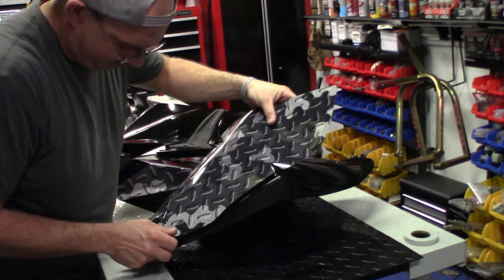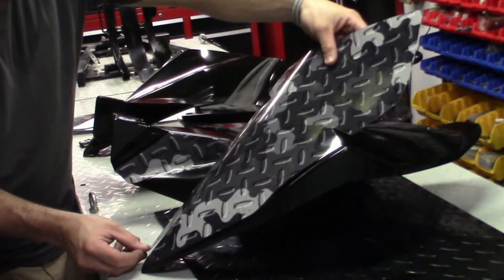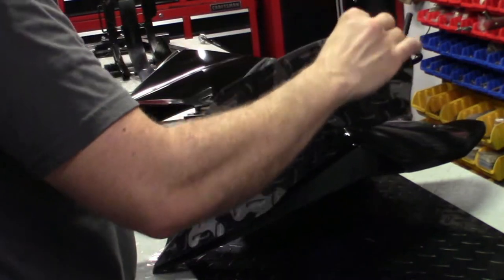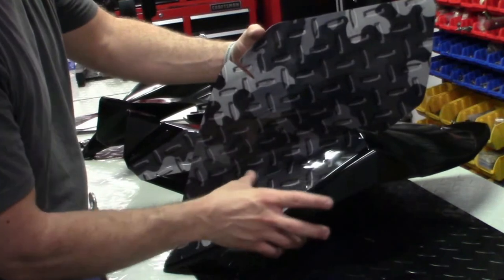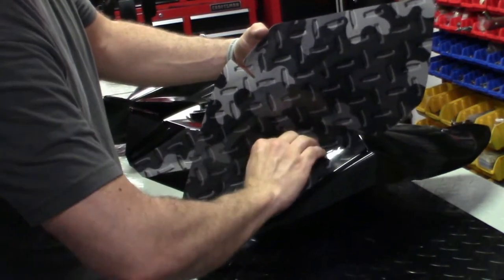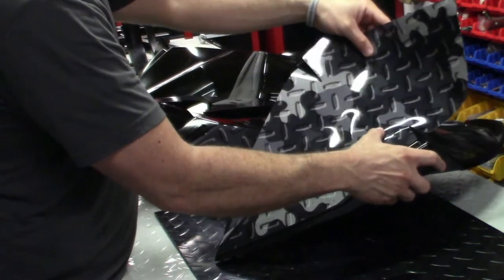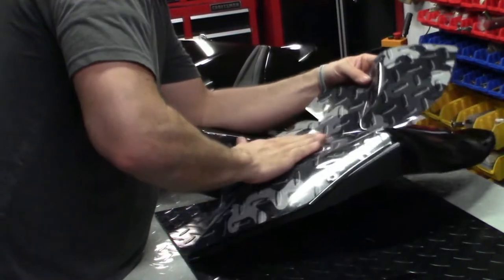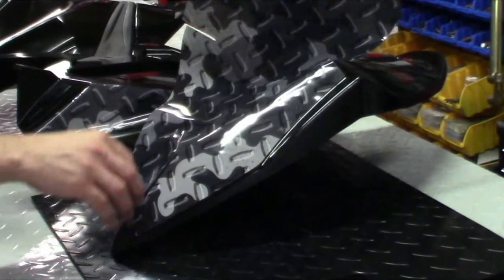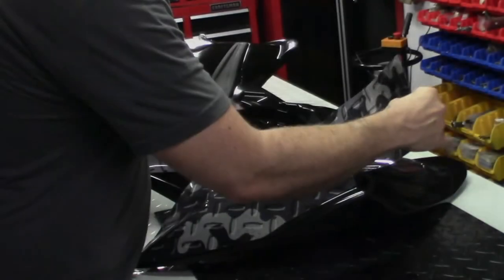Now this rear sticker was the worst. Probably should have used the squeegee and solution bottle for this because it's such a large area. I will say AMR cut this sticker exactly how it needed to be cut — you could see the V where it was cut for folding over. Before you apply this, make sure you test fit it so you know what you're doing. I did the outside first, working toward the inside, trying to push the excess air over the lip. You can see how it crinkled there — that ended up not looking real well. I actually got the crazy glue out and glued anything that was really sticking up to the fairings.